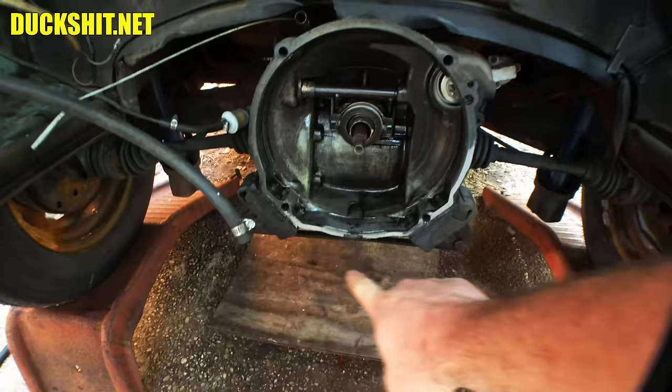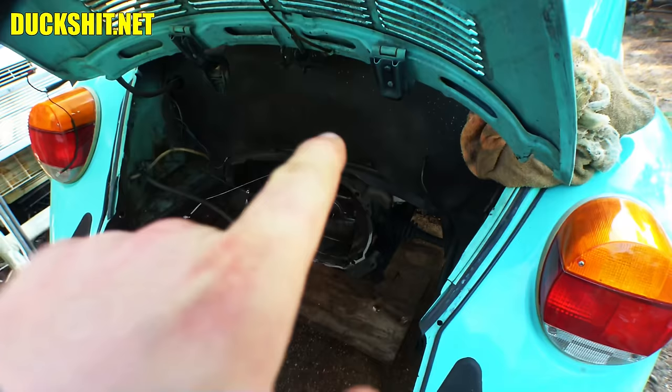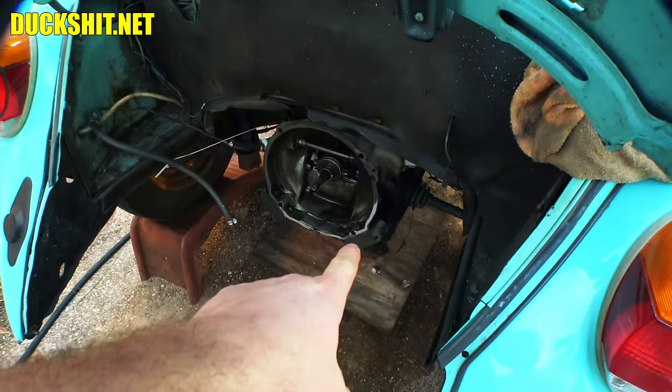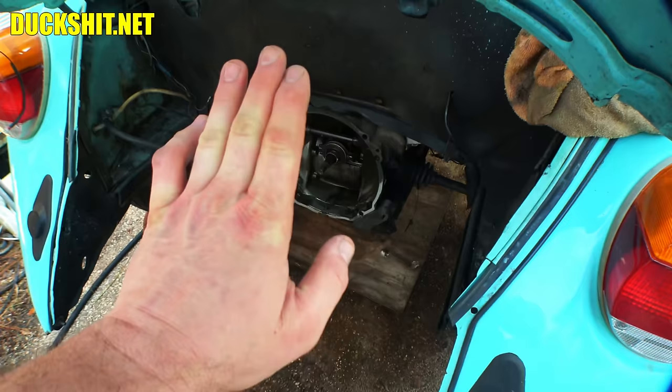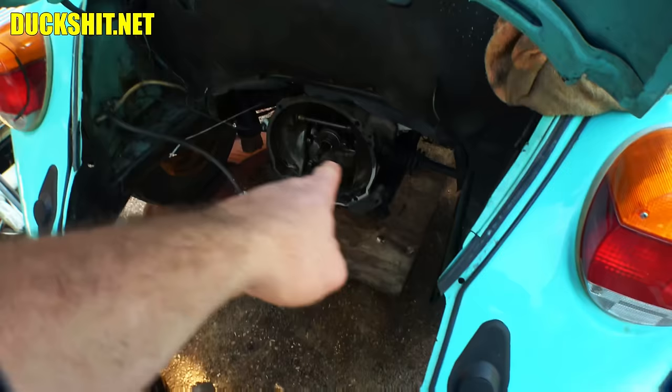From about here down the metal is kind of clean. The engine had no top engine mount bolts — one was tight, the other was finger-loose, so technically there was only one bolt holding it in. I don't know how that's even possible, because with just the bottom engine bolts in the engine wants to swivel downward. But looking at the wear mark in the bell housing, you can see it was definitely an issue.